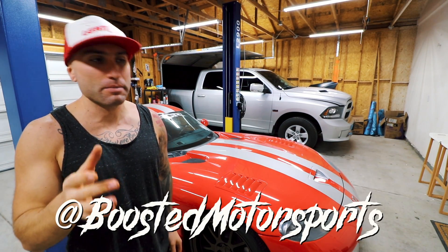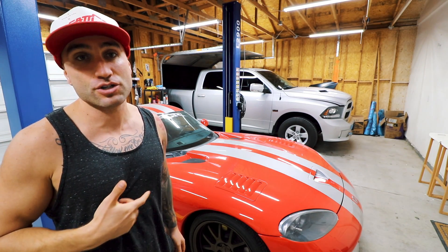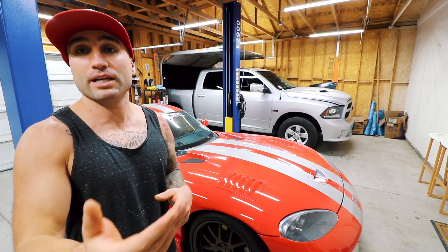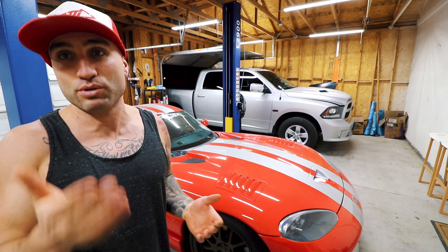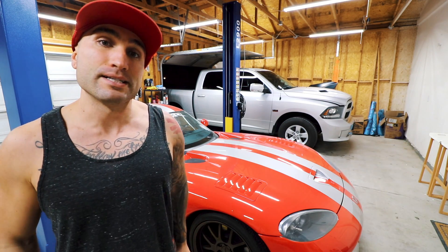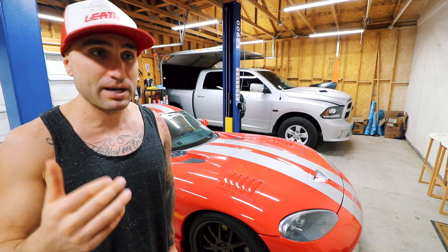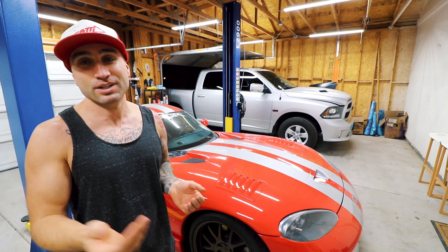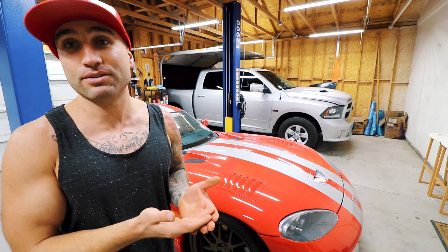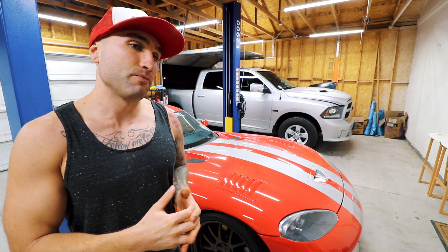In today's video I want to talk about something pretty vital to a supercharged vehicle, in particular the Ram 1500 that we have the Procharger kit on. The stock standard Procharger kit for the Ram 1500 5.7 liter Hemi slips quite a bit. A lot of guys are battling with slipping and to combat that they're either over-tightening the belt past what the Procharger manual recommends, or Procharger is verbally telling them to tighten it past their written spec to try to achieve the claimed seven or eight pounds of boost.